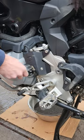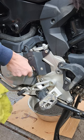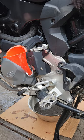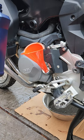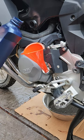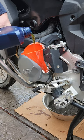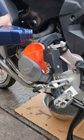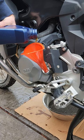Next we'll remove the dipstick, give it a wipe, and prepare a funnel to add the oil. We're going to add our 3 liters of 5w40 synthetic motor oil — I prefer to use the BMW brand but you can use whatever you like. As mentioned earlier, if you fail to remove that inner drain plug on the second reservoir you're going to be overfull after adding 3 liters, so keep in mind you must remove that second plug.